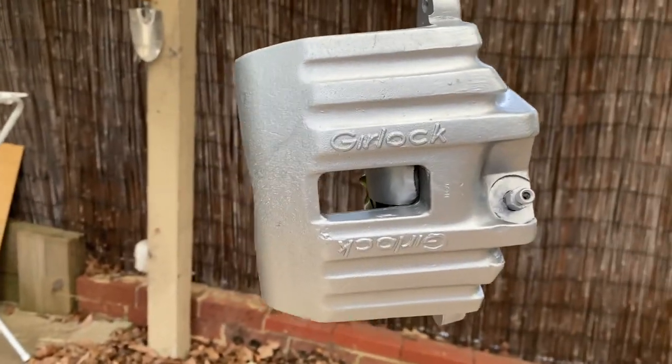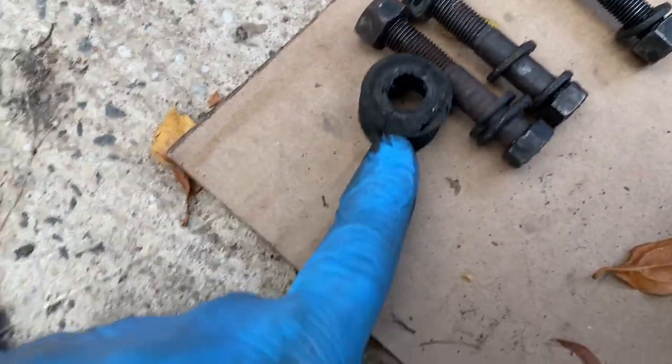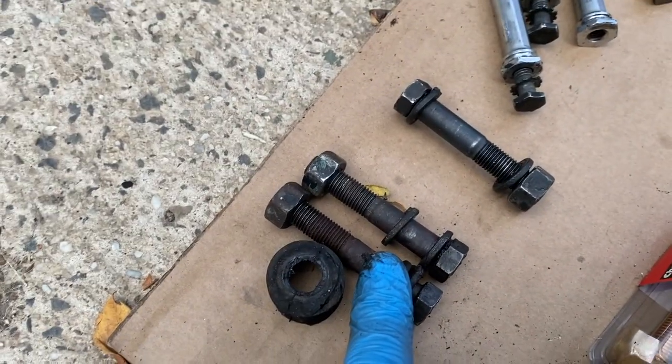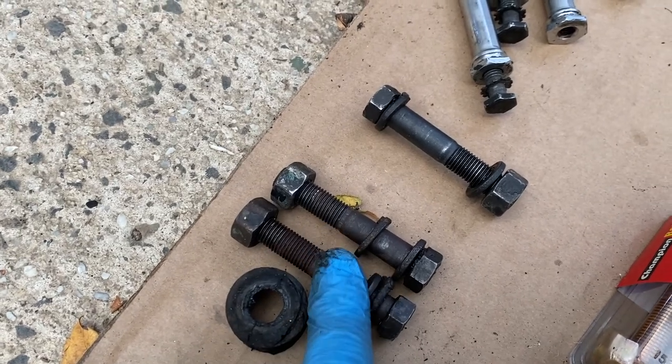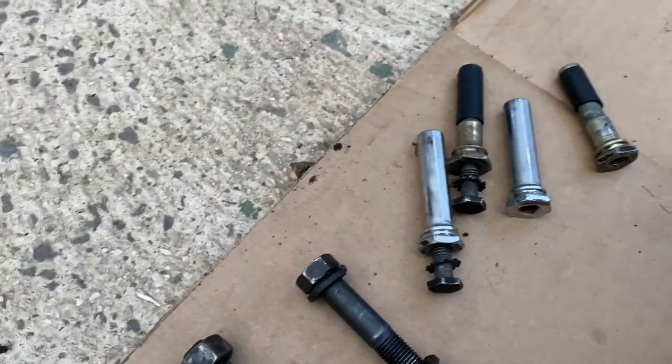But yeah, it's come up right. So these are gonna drop back in, and I'm just trying to get some new boots. Some of these little guys down here. I went down to Repco today and picked up some new bolts because I lost one I haven't been able to locate. There's a caliper brake bolt, and I'm gonna make do with these sliders.